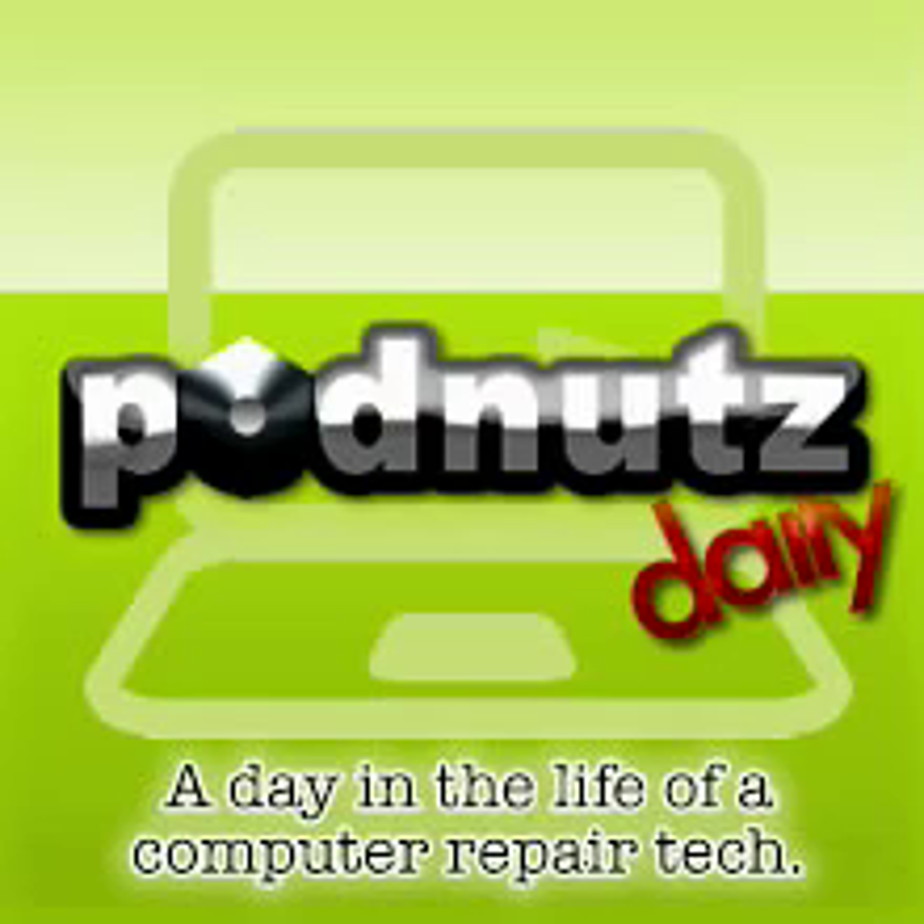These are famous for motherboards getting fried. We had one that came in. It was running slow. The customer said it would crash, and it would also give him virtual memory errors — running low on virtual memory. We thought he probably just had some kind of operating system problem where he didn't have enough RAM. We went in there and looked at it — he had plenty of RAM, and his processor was fast enough. Yet sometimes the computer would just act funny, things would go slow or wouldn't do things properly.